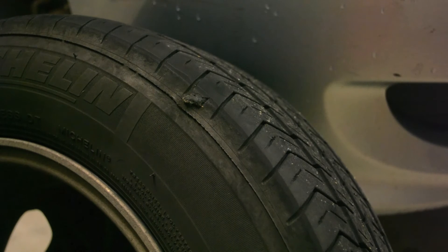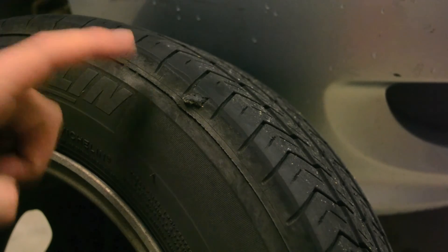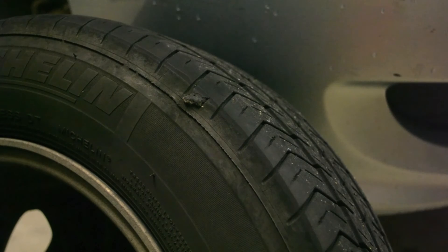I know there are pros and cons about this type of repair, but the one thing I really learned is: if you have a repair like this, you want it on the front of the vehicle. Originally I had it on the back, but it turns out you're far better off having it on the front — so if you did have a blowout or lost a lot of pressure, you have better control. If it's on the rear, you have no control over it.